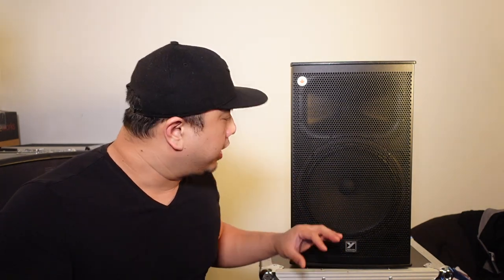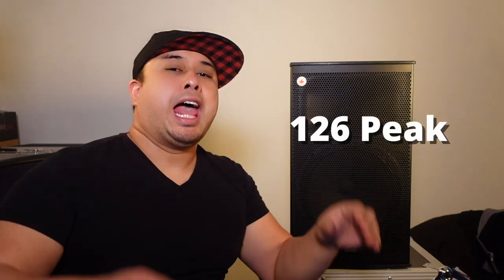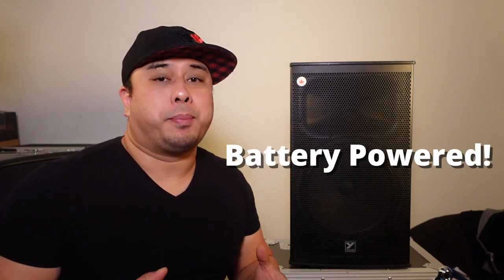I don't know if 60 watts is right because this thing gets really loud — louder than 60 watts in my opinion. But basically the SPL is what justifies how loud a speaker can get, and the SPL on this is 120 dB continuous and 126 dB peak.